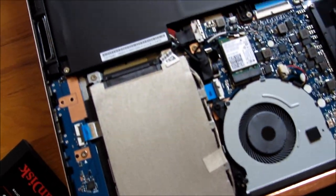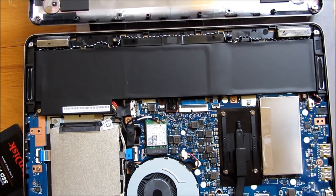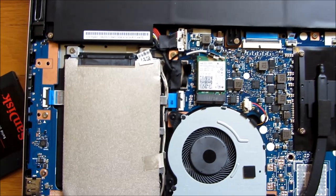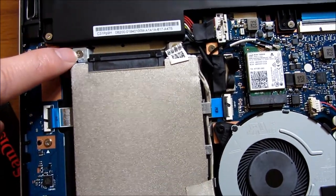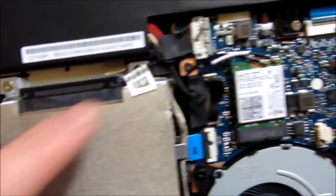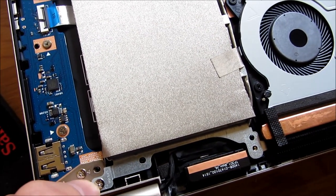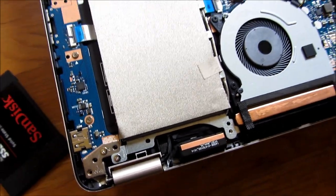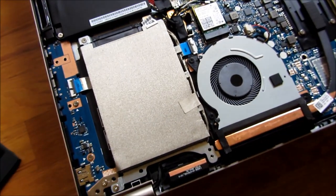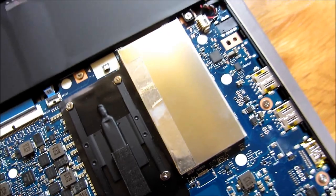So that's the hard drive. You'll notice that's the battery there at the top. I'm going to show you in detail how all this stuff is arranged. The hard drive has a cover, and there's just one screw here, another screw behind this, and also another screw here. So you take out those three screws and the hard drive can be lifted out. Then you can replace it — this is my SSD. That's the Wi-Fi card, and there's the memory behind this.